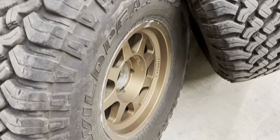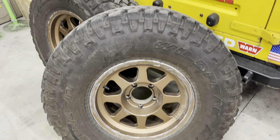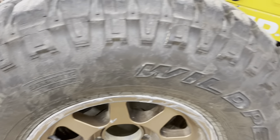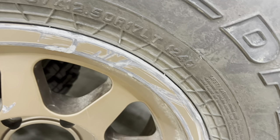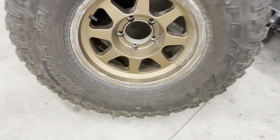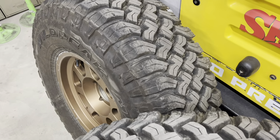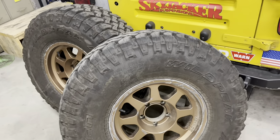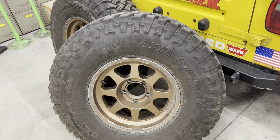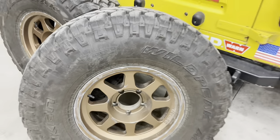Some of this video I'm filming after the fact and some of it I filmed before, but that's really because I did a really bad job of filming and documenting stuff ahead of time. So this is the tire and wheel package and obviously you can see I put these things to work. It was a good tire and wheel setup. I was able to air these things down — at most off-road parks I was running 7 psi in the rear and 8 psi in the front, which is extremely low for a non-bead lock wheel, and I didn't have any tire failures. I don't think I even burped any air out of these things. That's a good wheel and tire package right there.